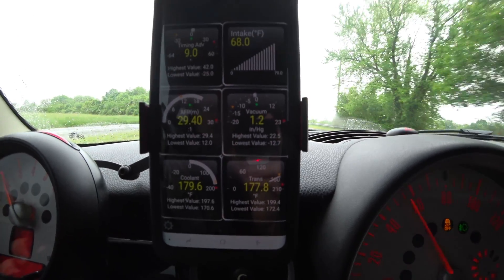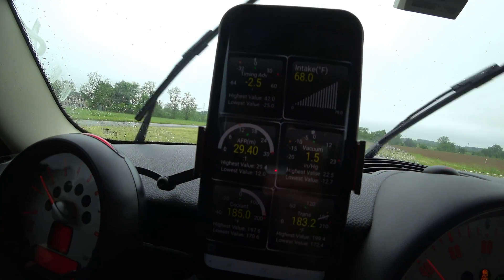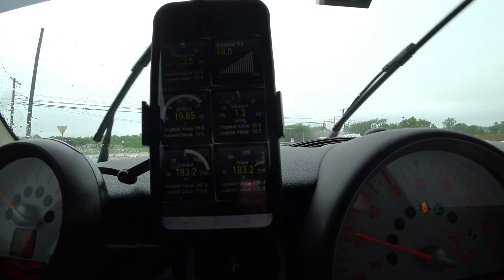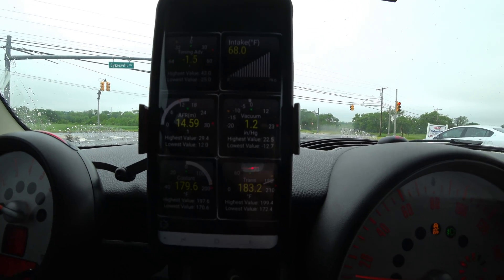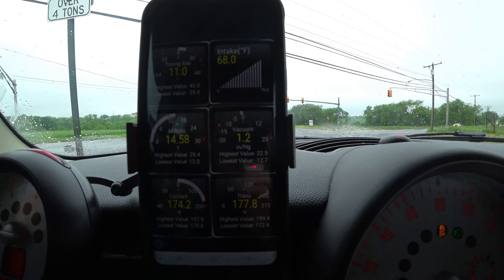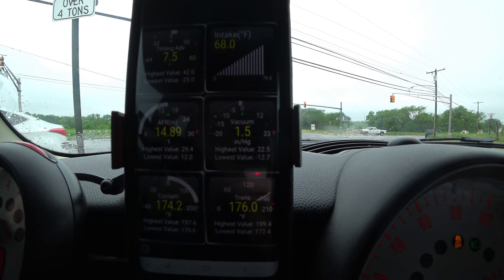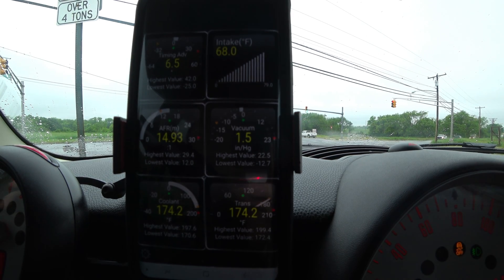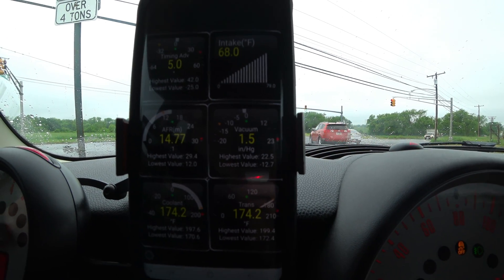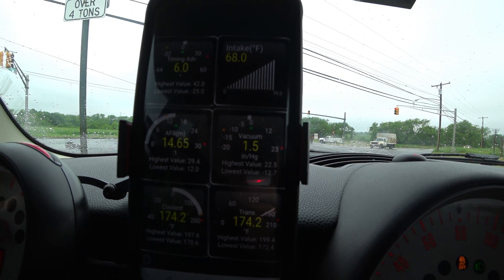So as you can see there, I got like a little digital bar that goes around that top part. Hopefully you can kind of see the AFR doing its thing too. I got to a 12.0 flat AFR. I was spinning a little bit, which is probably why it didn't really hit the target AFR all that great. But I did hit 22 and a half pounds — it's probably closer to 23 actually. One of the reasons I can't really see 23 is the map sensor's output to the ECU maxes at 22 and a half. It's not what it's fully capable of, but it's the maximum allowed to read back to the ECU. So I can't really see anything past 22 and a half PSI, but I'm tuned for anywhere between 23 and 24 PSI on this map.